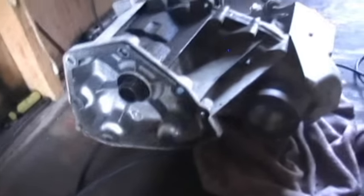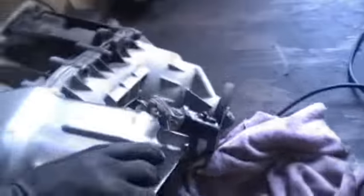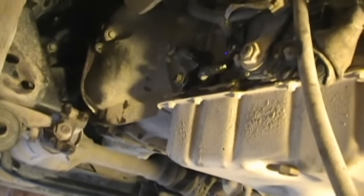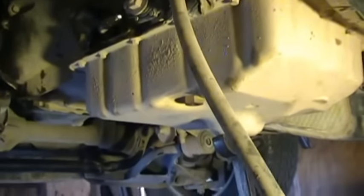The transfer case is okay — it's the transmission that gave me the problem. There's the transmission and the back side of it. Now I've got to take off the bell housing bolts — five bolts — and take off the three bolts on the flywheel, then slide my transmission jack under it and slide this thing out. I'll unhook a few wires. I take the socket and loosen the nuts way up, then stick my finger in to pull them out — you don't want to drop one of those in there when putting the transmission back in.